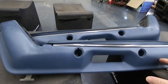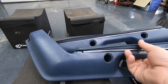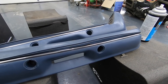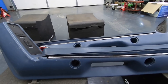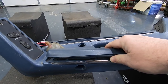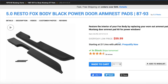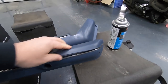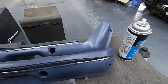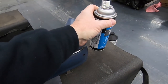These are actually the original armrests that came out of Project four to eight, and as you can see they're blue. Everything else is black — you can't have that. Overall they're in great shape; I've got a few scuffs and stuff but nothing you're gonna see once we get them dyed. Even the switch panels are in pretty good shape. Where you do run into an issue is typically your armrests. You can buy the armrest part from LMR, but you just can't get this part, so that leaves us in a situation where you have to dye. And it's not really hard.